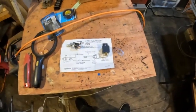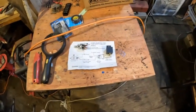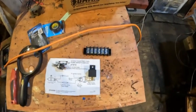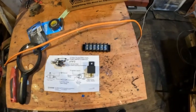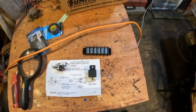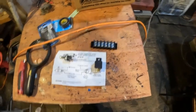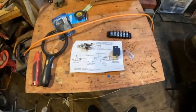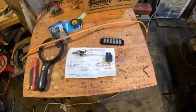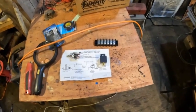I'm running a Pertronix distributor, so it's going to be protected in two ways — the distributor has a rev limiter built into it, so it'll be protected for both RPMs and oil pressure drops. This wiring block here is going to help me divide my wiring coming off those relays. In the end, most of my switchable things are going to use ground wires, like more modern cars, instead of hot wires all over the place — I think that makes it safer and it's going to reduce the load on the original fuse box.